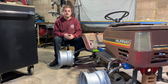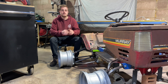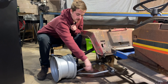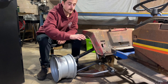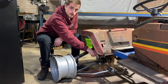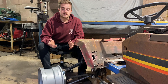This thing is pretty much a roller — it looks like an absolute beast and I'm super happy with how it turned out. The rear suspension is quite a bit wider than the front, and I've done that because I wanted more footprint on the ground, being that this thing is going to be 500cc. I was going to extend the front suspension in today's video but the welder ran out of gas, so I'll finish that in the next video. The rear arm is a little bit bigger so we have enough room to mount the shock absorber and the CV axle. The plan is to run a CV spool in the rear for direct drive on both rear wheels, and a chain drive differential in the front so each front wheel can slip and we can actually turn around corners.